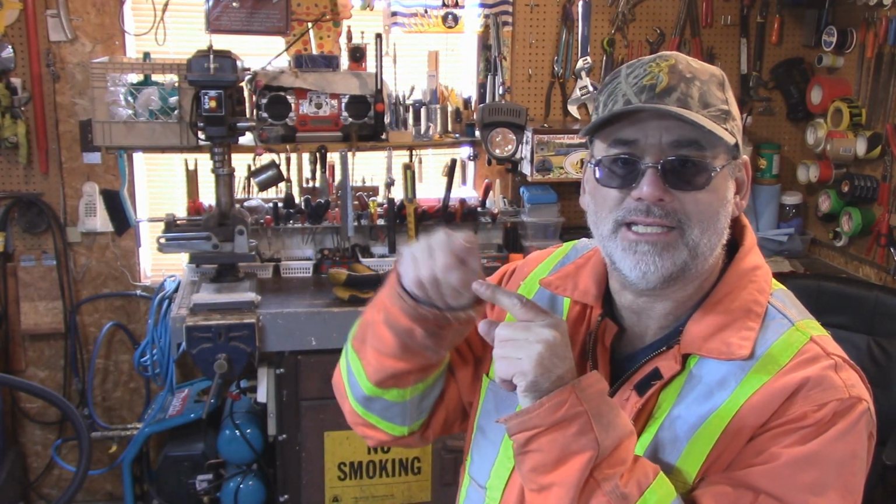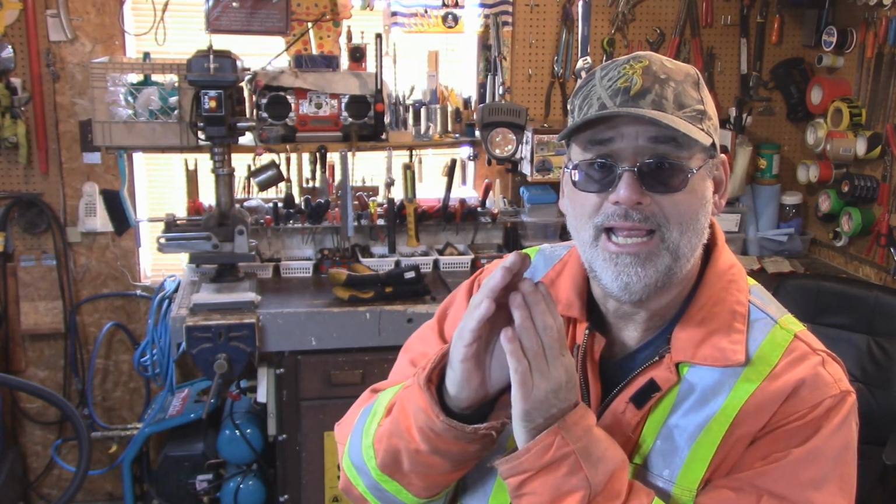Well, I'm back in action and it's working like a charm. The whole problem was when I put the new belt on, it was too tight. I think what was happening was it just peeled itself right off because it didn't have time to use the space between the actual auger housing pulley and the idler pulley. So yeah, it was my fault, but at least now you can see what is required if you want to put a new belt on. It's not hard at all.